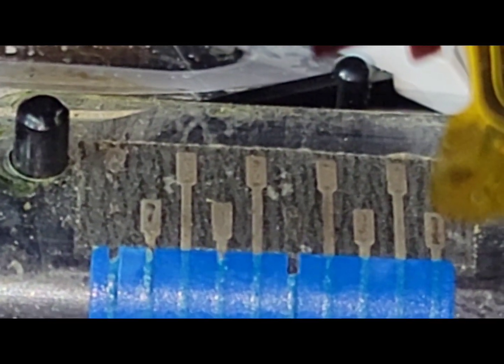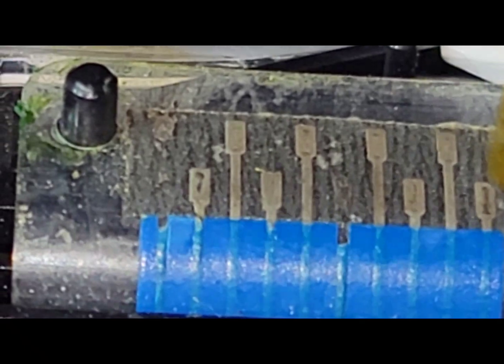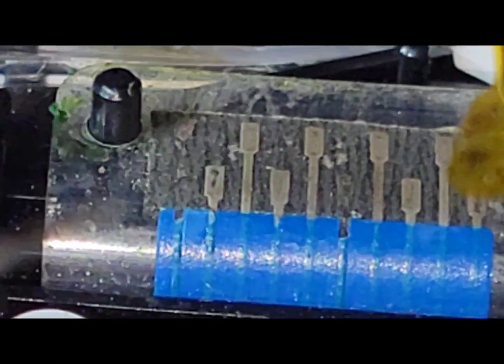And I don't think there's anything that I can do about that. You might be able to replace that ribbon, but I mean, you can see just where that data comes in or goes out is looking for is right here. And I'm telling you right now, there ain't nothing there. I can sort of feel that, but I don't feel anything here. And as for this side, it doesn't even look like anything's there. Period. So yeah, I bet you that's the issue. Part of the issue anyways.